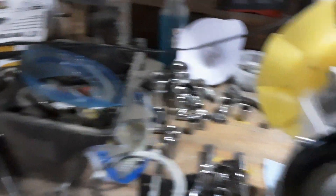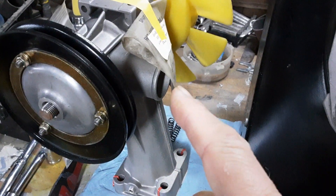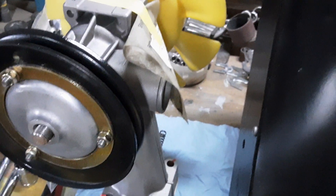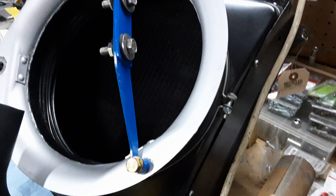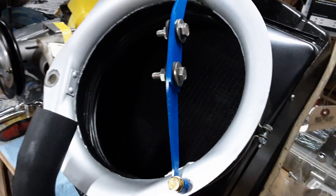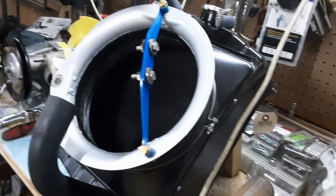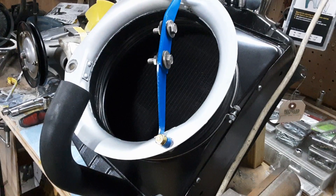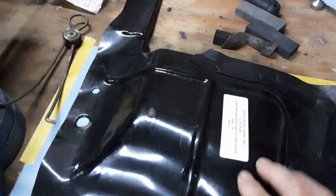We worked on the water pump — it's pretty much ready to install. I've got new lock washers, the shims are cleaned up, and everything's painted and put back together. We also have the radiator — if you remember, we got a refurbished radiator from Midwest Bayless. I went ahead and got the rubber on it and the ring where the water pump and fan mount. I used blue paint because I had it and thought it would give a little color contrast instead of solid black on everything.